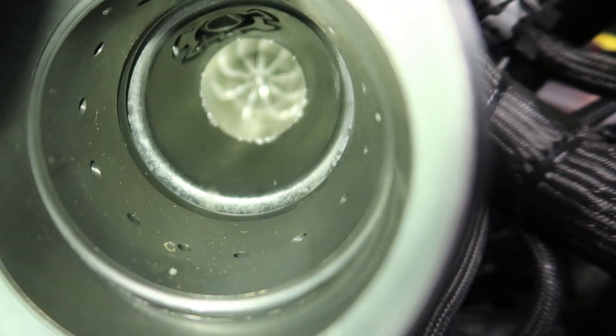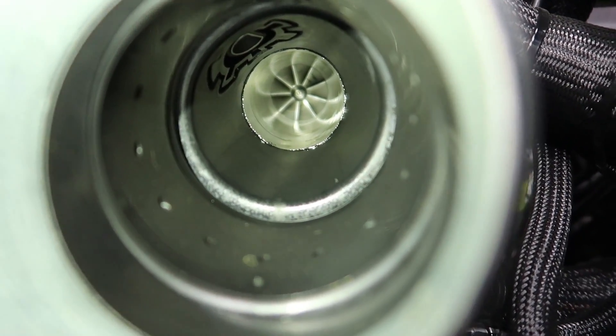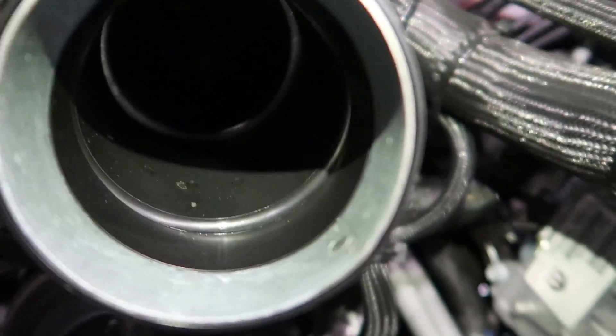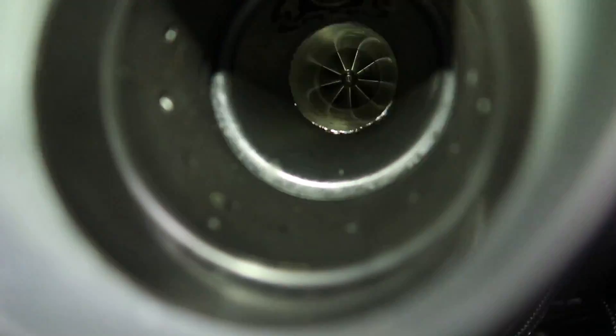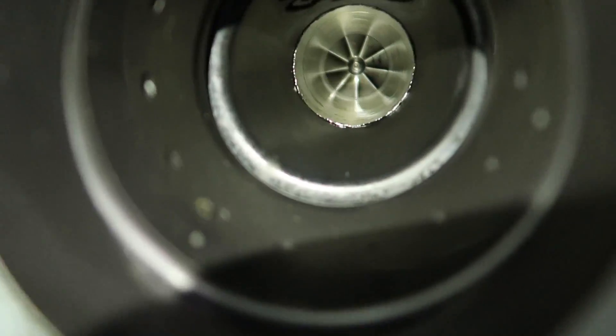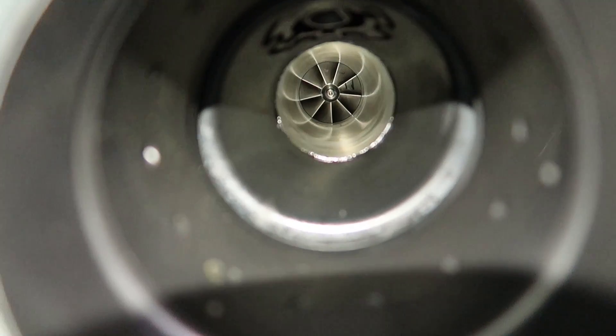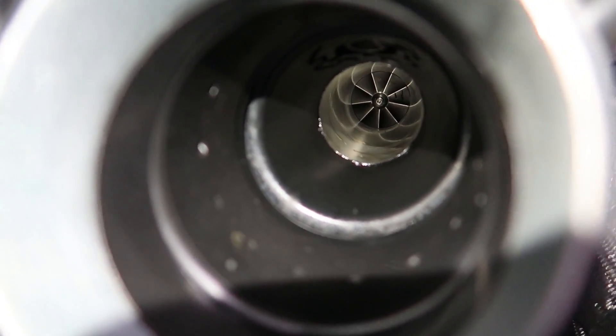You can see inside the turbo now. And there it is — the turbocharger. That's a cool little design there around the blow valve inlet. You can see the muffler right here — it has these little perforated holes on it. It acts like a resonator for the turbo so you can't hear the spool. Believe it or not, I already have oil inside my turbo. Yeah, this car is pretty much new — it has about 10,000 miles on it right now. And yes, I'm already seeing oil inside the turbo inlets. That means it's a perfect time to install this oil catch can. You can see there is shiny stuff around the turbo inlet — I can see it with my bare eye really well. So there you go — you can see the oil just sitting around there in the intake. So yeah, that means we need to install our catch can on this engine.